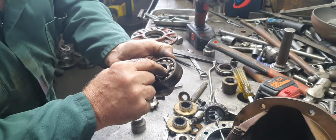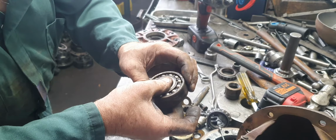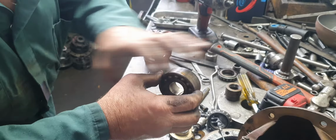Why have they got the cutout? Well, so they can load it up, put them all into those cages. So they have a little tiny cutout there. That little cutout will damage the bearing eventually if it takes the end thrust. It's all right for the overrun, when it's not so much end thrust. So it's been in, and I'm pretty sure it was in the correct way.